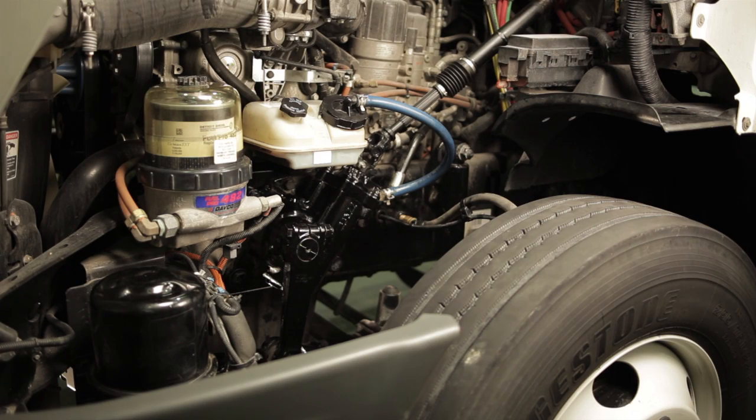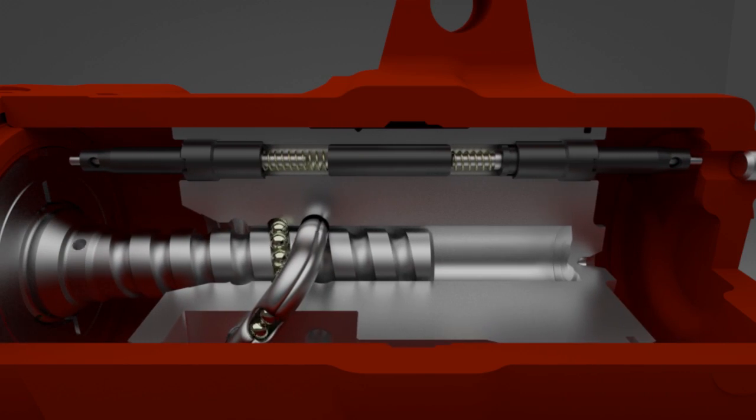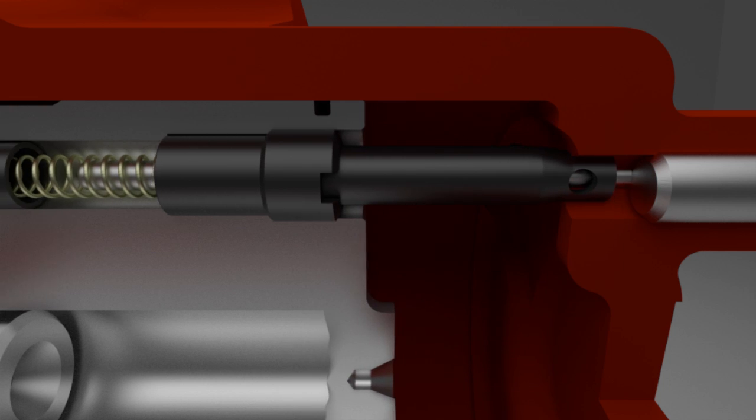The final set position of the adjusting screw may be different for each vehicle due to axle settings, degree of axle cut reduction, and other factors. However, be aware of two important things: leave the adjusting screw in the gear because it is now part of the steering gear assembly, and the adjusting screw cannot stick out more than 1 and 1/16 inches beyond the jam nut for proper thread engagement. The resetting process is now complete. Lower the vehicle, remove the tire blocks, and fill the reservoir if required.